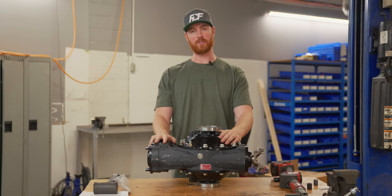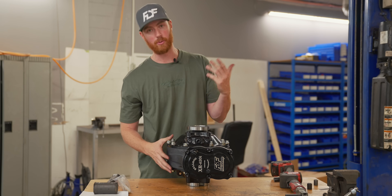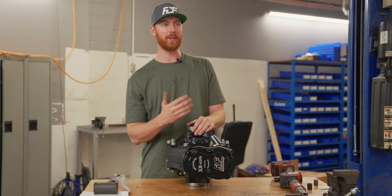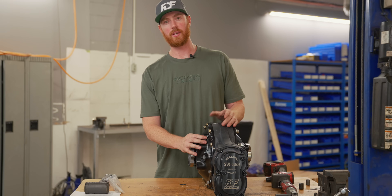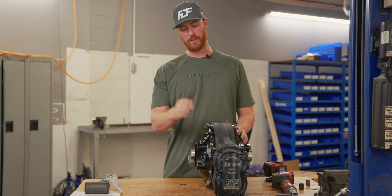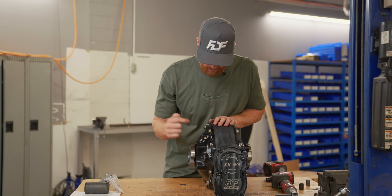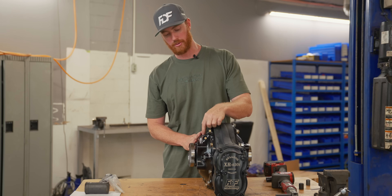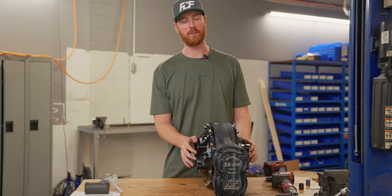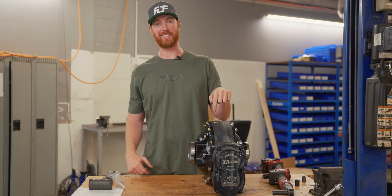I have run these three diffs on three different cars and they have all been flawlessly working. The one thing you'll want to do is block the breather — it's a one-eighth MPT fitting. Everyone in Driftmasters has it blocked. We had a two-meter-long relocation with a breather and it was still bleeding oil, so you can plug it — it won't blow the seals, it'll work perfectly fine. I do recommend plugging it because otherwise you'll end up with oil dripping. It's not a flaw; under different circumstances the breather works fine, like on dirt track. Thanks for watching — we'll see you in the next video.